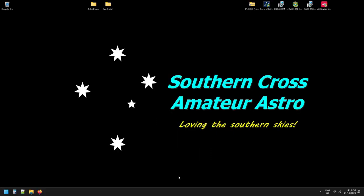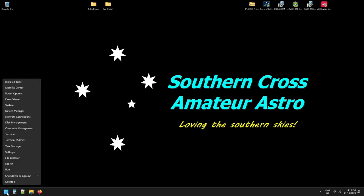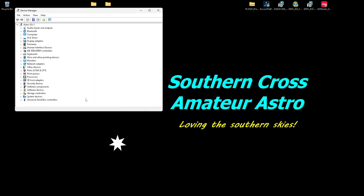Now, to check if you need to install one or you have one already installed, this works on Windows 10 and everything else as well, so it's not a problem. Simply right-click on your Start button and go to Device Manager, or go to Device Manager any way you like. Now, if your mount is not connected and plugged in, even if the driver is installed, it won't show up there. That's why I'm calling this a magic one, because it only appears as needed.